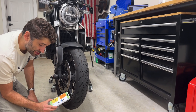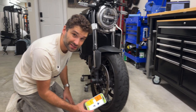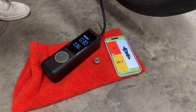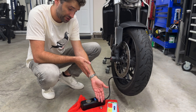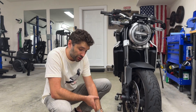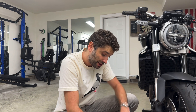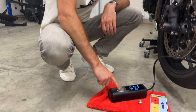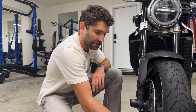Checking sensor details, saving to cloud — and look at that, it's alarming already: 29.7 PSI. This tire is low. So we're going to use our pump to get these up to pressure and see how the sensors react. The app is showing zero pressure in the front, which is correct because the sensor is off. The pump is also showing 30 PSI, which is concordant with what the app was showing. We have it set to 36, let's get it going.